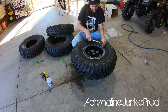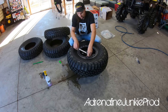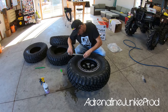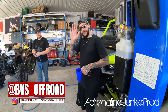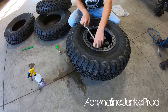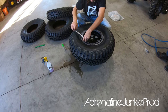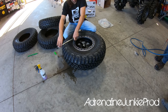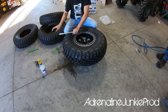This is the worst part. Finishing it off? It just takes so long to put these on. But beadlocks are the key — you want beadlocks. I will never run without beadlocks if you're running below 10 pounds. We're all standing here watching you work your wrist. It's like you think you've torqued them and then you haven't, because they keep pushing the rubber down. You could go through there for hours. You need like eight laps.